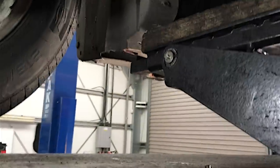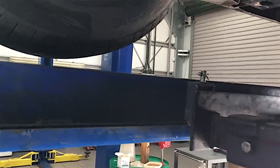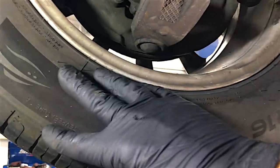Now, I've just jacked the front wheels up, and on this particular four-poster ramp that I'm using, I would generally check the inner wheel rims and the inner sidewall of the tyres. But one important thing I do check on these cars is these drive shafts, because they tend to get knocked out on the inner joints. So I would get my hand on that drive shaft like that, and wriggle it up and down like that. Then I would turn the wheel round just a little bit and wriggle it again and keep doing that, because sometimes you won't get the play.